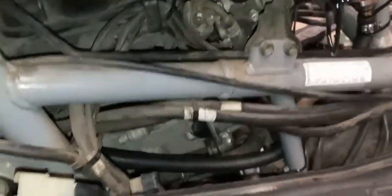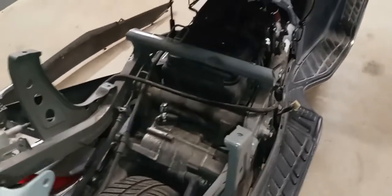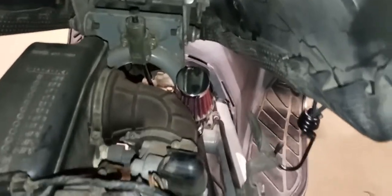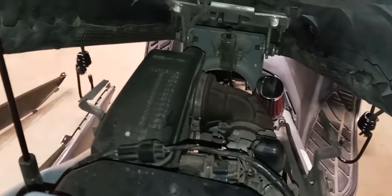If the theory holds correct — and there was another guy on the forums years ago who said something about relocating the breather and separating it from the airbox, and he claimed it solved the oil consumption problem — so that'll be my test. You can see it right there, different angle, and that cavity there. That should be well within the boundaries of the tunnel plastic. Where the breather filter is going to be sitting is going to be right about there, just inboard of that curve.